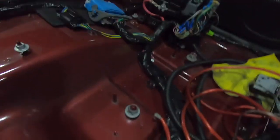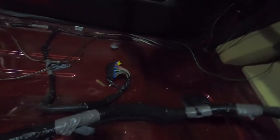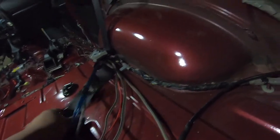There was a self-tapping screw right there — it seems like they just cut it off and then tapped into the power cable on the fuse box. I had removed that before I started tearing this apart. Here are just some speaker wires going through the door boot for those speakers — same thing on the other side. All those wires I showed earlier that were spliced into with more speaker wire are all coming off. For the camera, they used speaker wire for the power and ground and a regular RCA, so I'm about to cut this off and remove the backup camera.